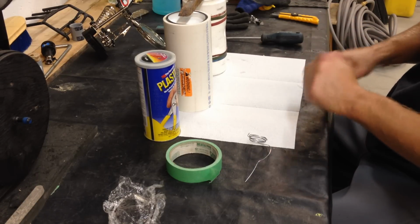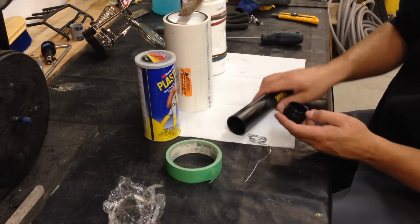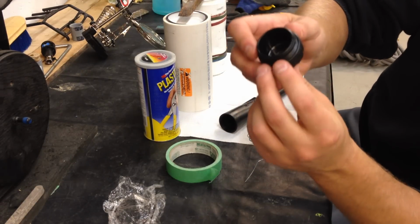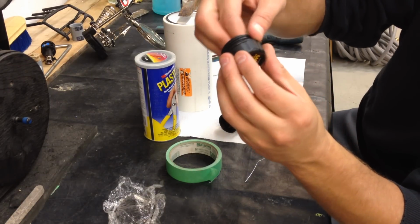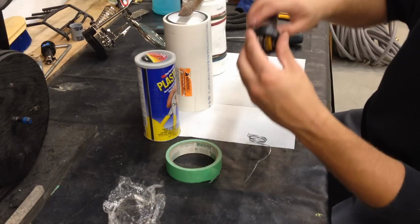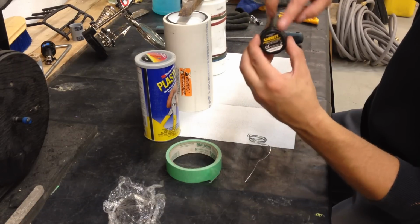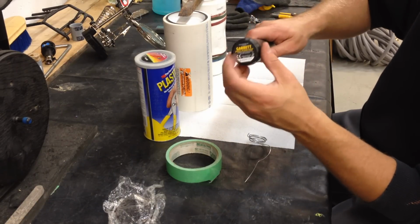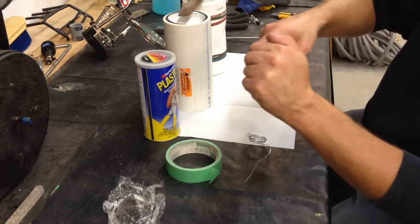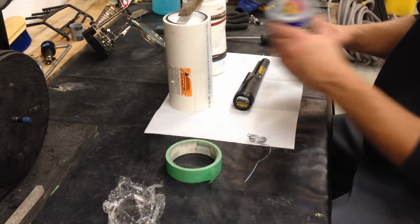So what you're going to need: take your battery out, take an O-ring, any kind, elastic band, and squeeze it around the threads here just so it gets on top of the cap, like so. What that's going to do is create a spacer for us, just so the Dip doesn't seal the cap where you put the battery in and render it a pain or useless. So, wipe it all off, make it clean, open up your Dip.